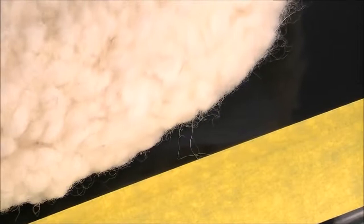Okay, so we take care of that haze. First thing I got here is the rubbing compound. I'm going to use a wool pad. I've taped that edge off there just to kind of protect that edge so I don't burn through with the polisher. And try and set it around somewhere between 1500 and 2000 RPM.